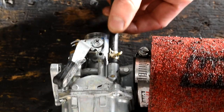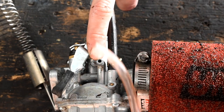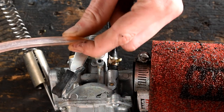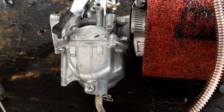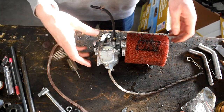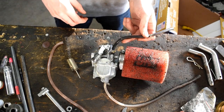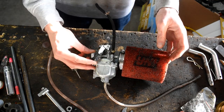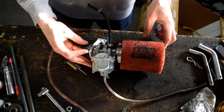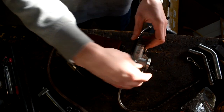Let's get familiar with what we're looking at. Here's your fuel line — this is going to be your fuel. This one is just a vent, which has the original pink tube and just breathes to atmospheric, so it just goes down to the ground. The bottom piece is also just a breather, so that also goes out to the ground and atmospheric. The only thing you need to plumb in is the fuel line. Here is a two-stage choke: up is choke on, down is choke off.